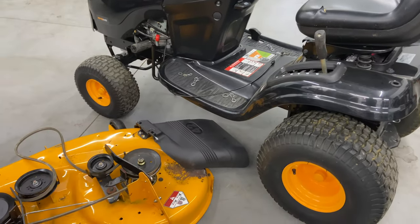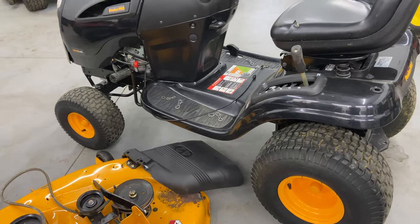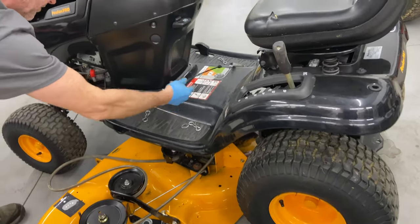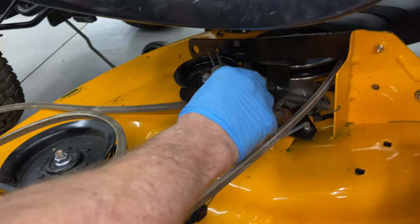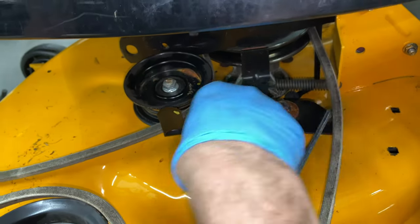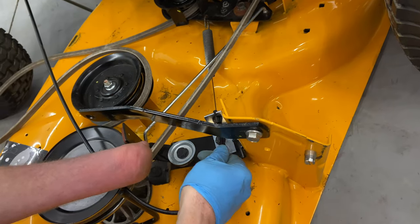That's how you take off the mower deck. Now I'm going to reinstall it and show you how to make this deck adjust a lot better side to side by putting on an adjustment bracket. We're going to slide the mower deck back under and basically do the reverse of what we did coming out. I'm going to put the cable back on — slide it underneath the belt and underneath your brake. Be careful you do not kink the cable. Have the opening 90 degrees into your eyelet on your blade engagement bracket. Pull slightly, get the cable in between the slot, push this in — now it locks. Push it under.